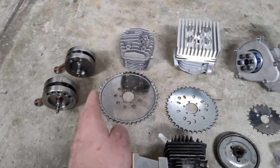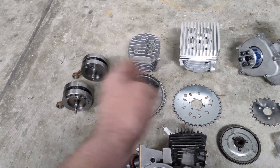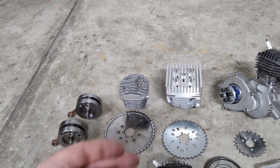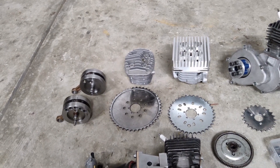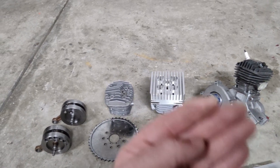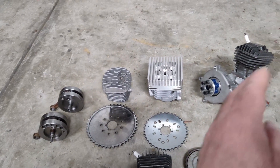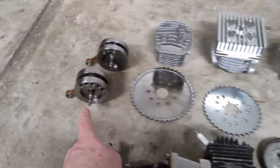You've got a crank. The cranks are designed for a 47 millimeter piston — most of them in the 80cc kits. The YD-100 is designed for a 50 millimeter piston. You drill the two holes and all that to offset the weight of the piston. You get something bigger and heavier like that, or one of the bigger saw builds, and then you've got to take out more weight — like the 54 millimeter one and so forth, or the 56 millimeter MS-660 — and you've got to take that out.